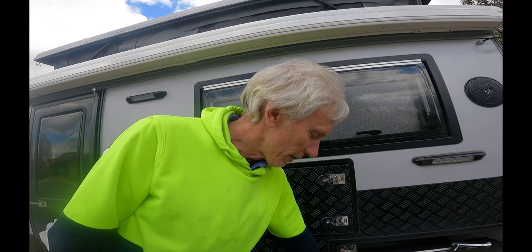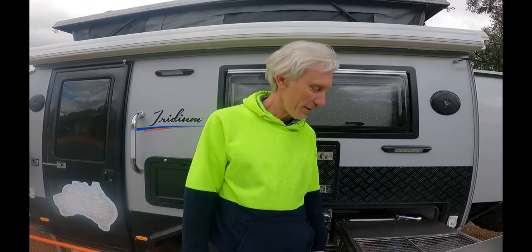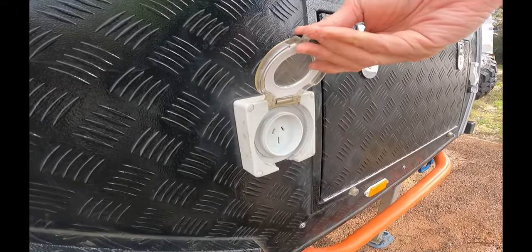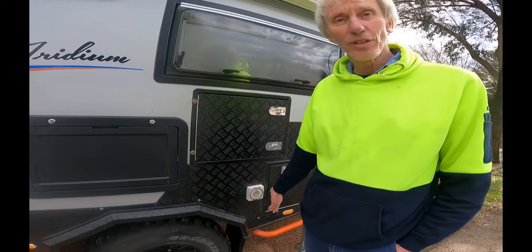One thing I've learned is when disconnecting, turn your water pump off and relieve the pressure on your tap before taking these out, otherwise you'll get wet - which has happened to me a few times at the start. We love the fact that we never have any food smells inside the van. There's also a plug here - apparently if you're camped next to another van, they can plug in from you and get power, though you have to be careful how much power is used as it's only 15 amps.